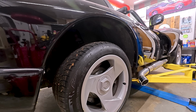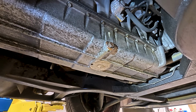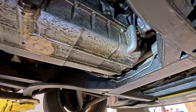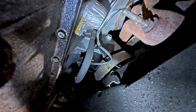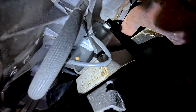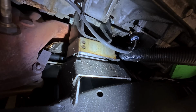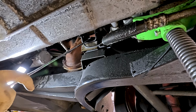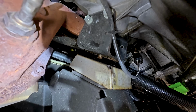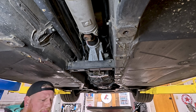The big thing here is to go after the engine and transmission mounts. When flooring the accelerator or shifting aggressively, the gear selector moves violently left to right, and the big heavy torque monster of a V10 isn't easy on the rubber isolators trying to keep everything in check. These engine mounts are completely separated, but luckily replacing them is extremely straightforward. Remove the bolts, lift the engine, swap them out, and put everything back together. The same goes for the transmission mount.